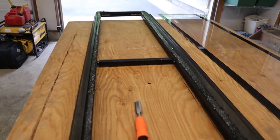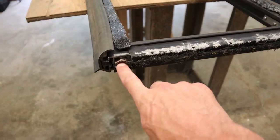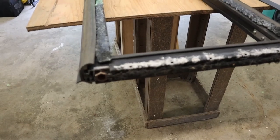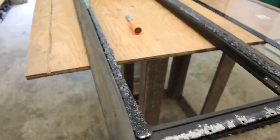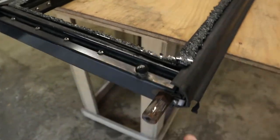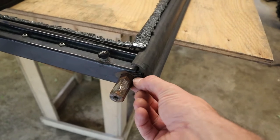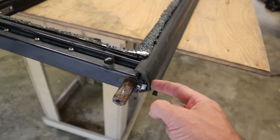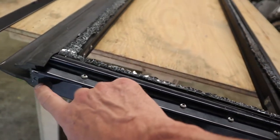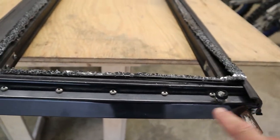Here's the door that I've placed the glass back in temporarily. That point right there is where the first bolt we showed you previously screws into — that's the bottom pivot point for this door. To get this thing to come apart, in each one of the corners there's one of those bolts. It's a square drive — you just unscrew it, which takes that clip out and helps keep the molding from coming apart. There's one on each corner, so you're going to take all four out.